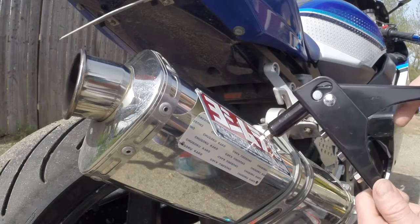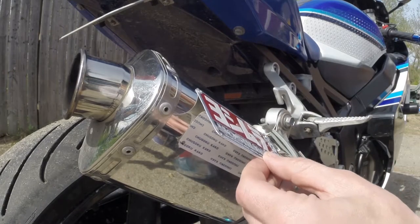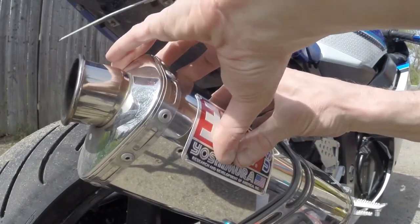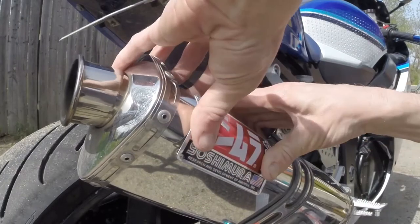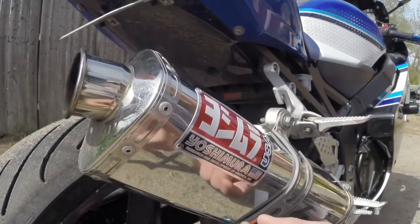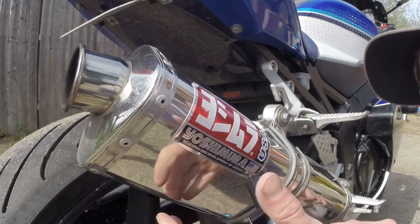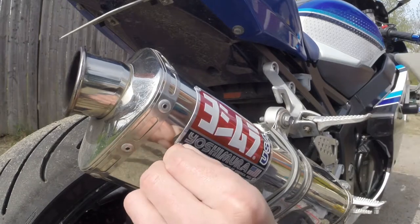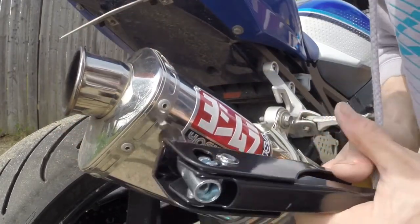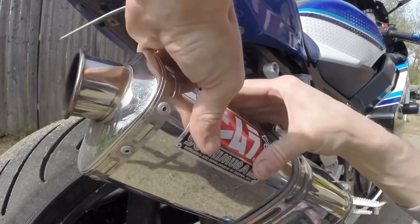Remove the old needle and complete the other side — there you go, two rivets. Now peel the rest of the adhesive backing off slowly and carefully, working the badge down to make sure it's firmly pressed against the muffler with no gaps, bends, or anything like that. I had to pry it up a tiny bit at the bottom to get the rivet lined up without it creasing or bunching up. The final rivet took a little bit of pressure to get it flush against the muffler.